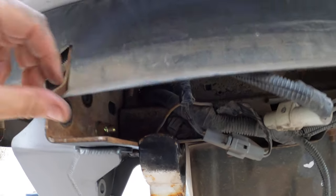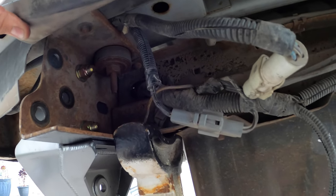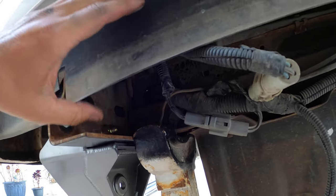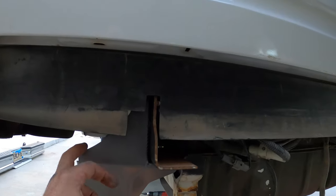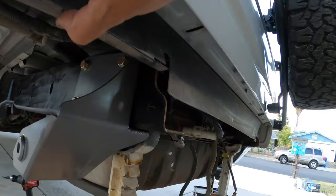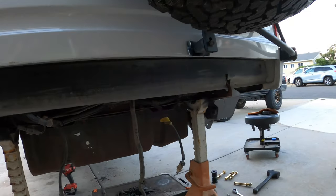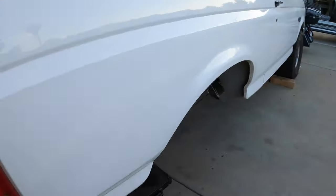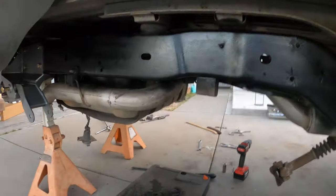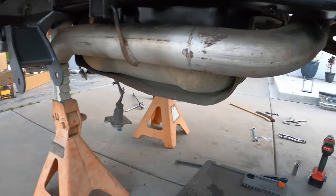This side really sucked - there's a hole right up in there and this side actually has a wire loom going through it for the taillights and all that. You can kind of see the head of the bolt right there. Also, I had to take the bumper off because these rear brackets come in contact with the rear bumper bolts, so you have to take those off to get the rear brackets on. Let me move around to this side.